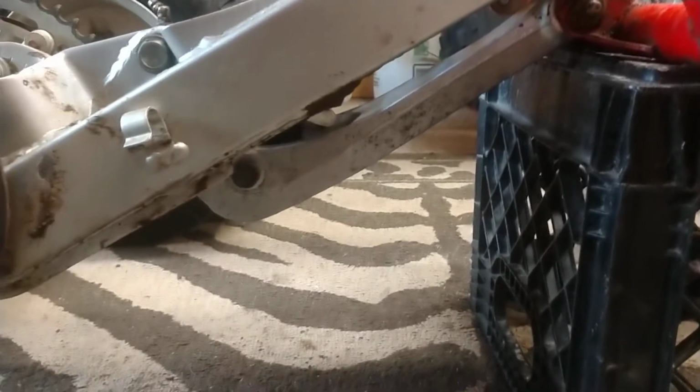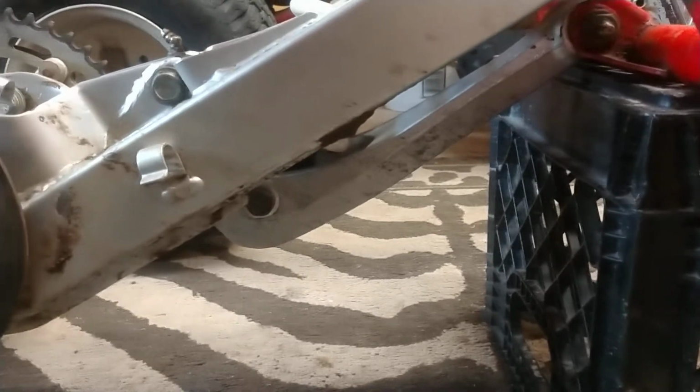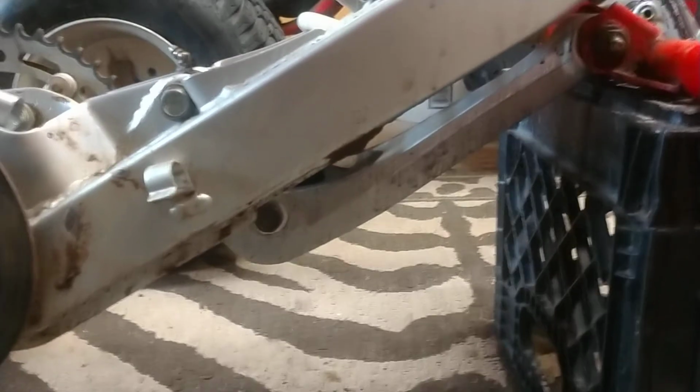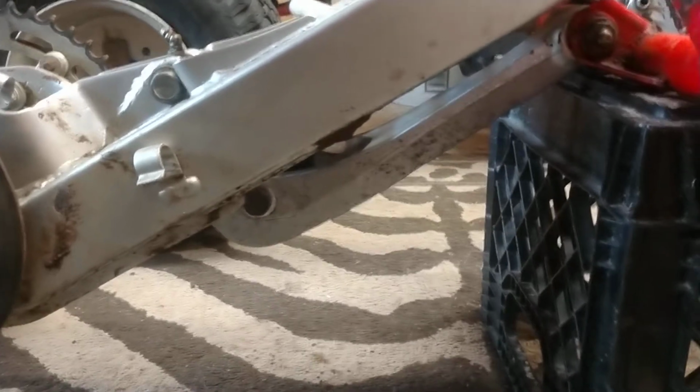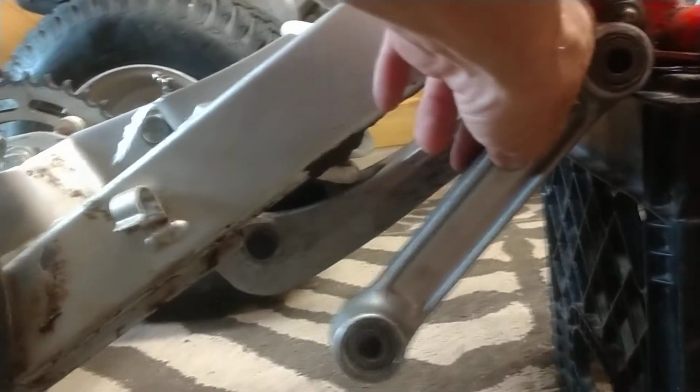So the advantage to this one is that if you're going to skip over stuff and it'll hit the back tire without screwing up your linkage maybe, or having a problem there, like, you know, something bad could maybe happen with that 350 dog bone sticking down so steep before the tires can hit it. You know what I mean? This one will scoop better. But the way it works is totally different.